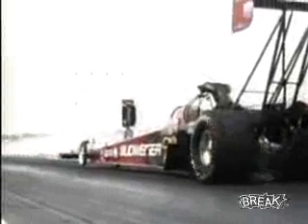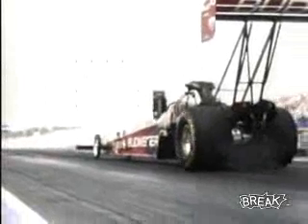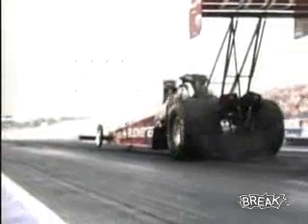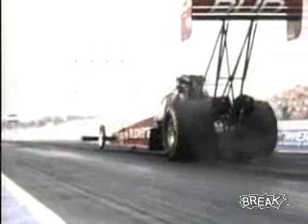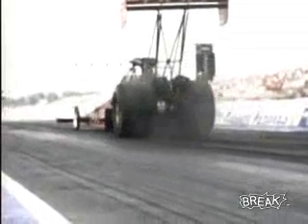Let's look at this run right here. Look at it wadding the tire up. Now it's going to start spinning. You see the individual cylinders firing at about 8,000 RPM right at that point, and the car's accelerating plenty fast right there, but it's also slipping the tire. You can see a little bit of clutch dust out of the back — slipping the clutch and slipping the tire, but still accelerating very fast.